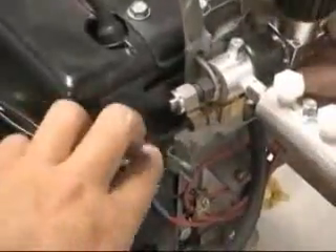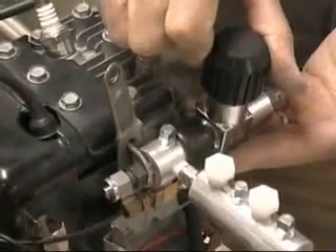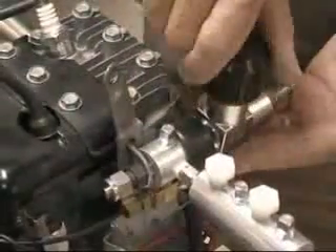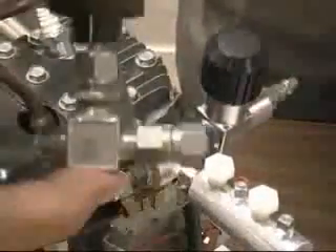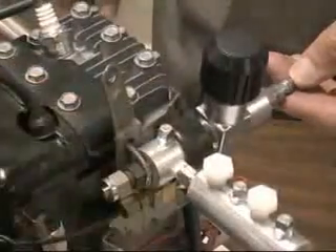There's the tube right there, and there's your valve. This needle control valve is your idle set, and you use the other one to really change speed. You can set them up so that you do everything on a hand valve, or a combination of the hand valve for idle and the acceleration valve for speed changes. This is the idle-type valve and this is the acceleration-type valve — and you can do everything off of just those two.